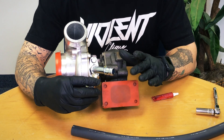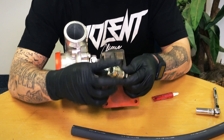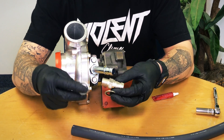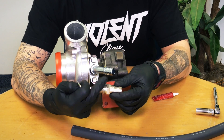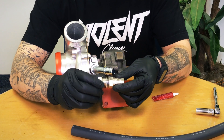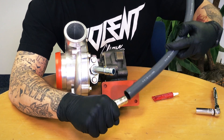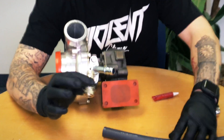You no longer have to drill a hole and weld a fitting to your oil pan. Instead, what they've come up with is: simply drill a hole, stick this fitting in there with a washer that has a seal built into it to prevent leaks. That goes through your oil pan, another seal on the other side to prevent leaks, and then we tighten it from the inside of the oil pan — creating a sandwich effect. Now you have oil exiting the turbo and going back into the oil pan. I'll show you that later when we move on to the oil pan part.